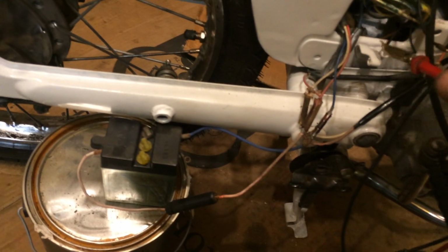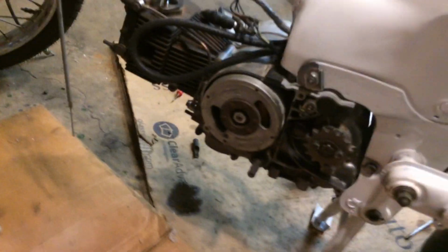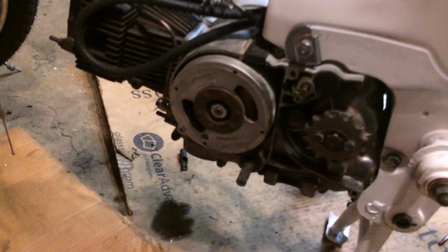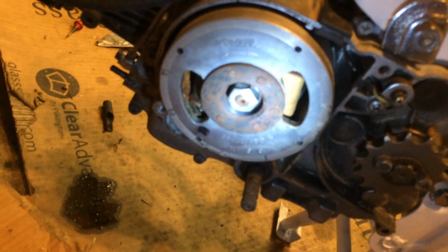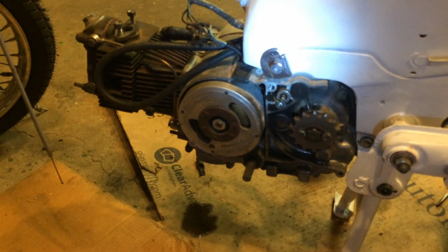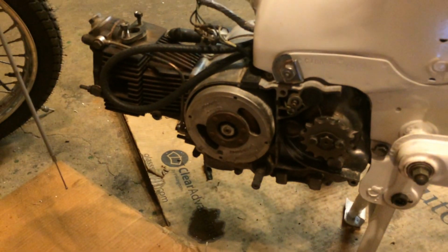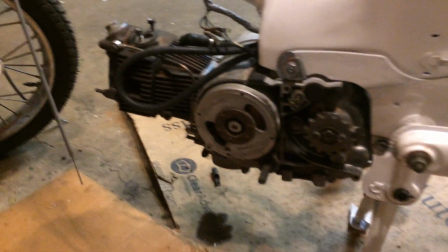So, let's shut that off. That's annoying. I can hear it warble, but I can't make it stop. And since I can't make it stop, I know there's something under this flywheel that's grounding us. Now, that being said, I'm going to push this in the corner because I'm going to need that puller. I'm going to have to get online and buy a puller tonight, but it's going to be several days before I see it, probably. So that's where we're at now.